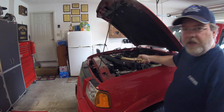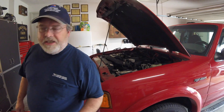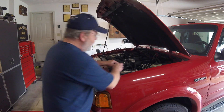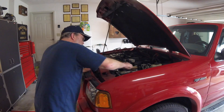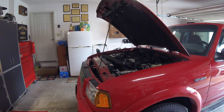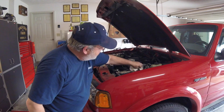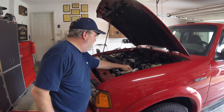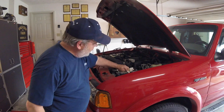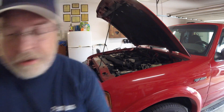You probably need to do this to the white truck as well. You know what they say — the plumber always has leaky pipes, a mechanic's car always needs work. I think we'll call that cleaning up the residue off the top of the battery. All this excessive off-gassing — that could be the weather where it's been hot and humid, or it could be telling me that the battery is starting to go south.